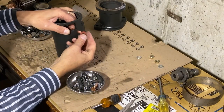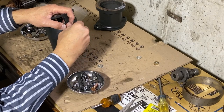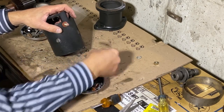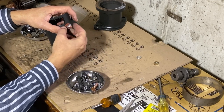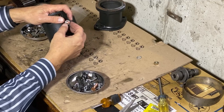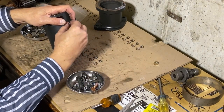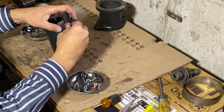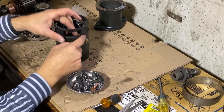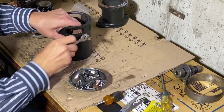So another neoprene washer here, the first one. So a neoprene washer, first nut, the standard washer, and then when you have your cable that comes here, it'll go on here, and then your lock washer, and then the final nut. Okay, now this has to be tightened, and I should straighten it up as I do so. Half inch.